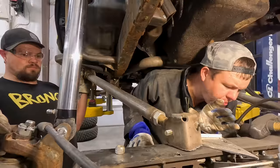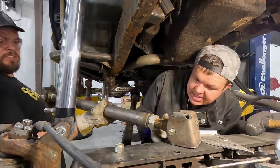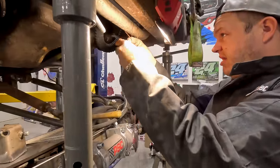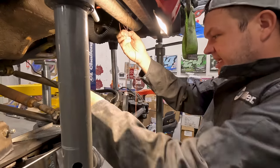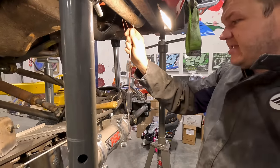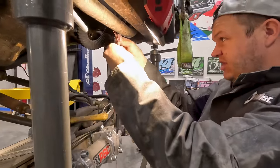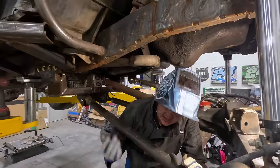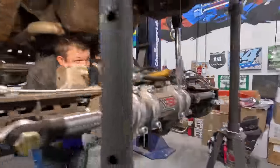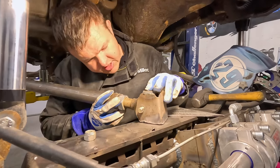So we're going to go somewhere like that. We've got to center this axle because it shifts — we want to make sure it's perfectly centered. Then we'll get that upper tacked. I'm going to set my plumb bob up. Because I can't get this back in there where I need it to be — directly above the axle — I'll just put it right here. Once I get this plumb bob centered, we will adjust the axle. It's 25 and a half, so Hillbilly's going to pass the bar in.